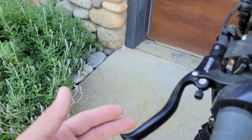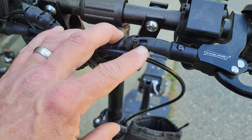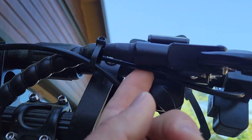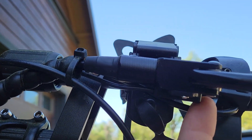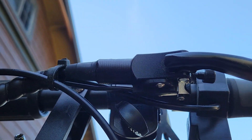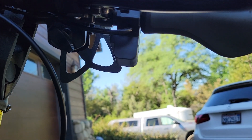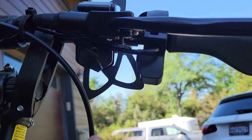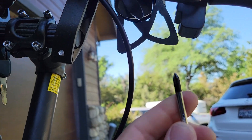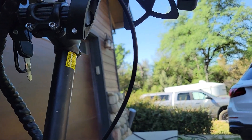So there is a secondary control. This is basically what goes to the actual brakes — it's hydraulic, full of mineral fluid, and underneath it there's a little electric wire that goes to a magnetic switch. See if we can get a good close-up of that. There are two Phillips head screws holding this magnetic switch onto the brake lever assembly. This magnetic switch disengages the throttle when you pull the lever and also engages regenerative braking if your scooter has it. After disassembling the switch with a simple Phillips head screwdriver — just two screws — it's very simple.